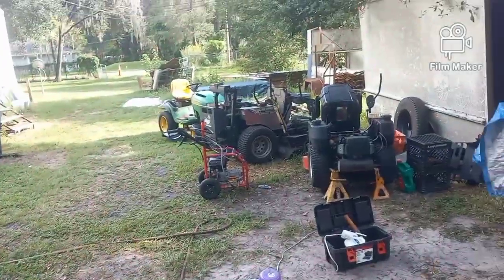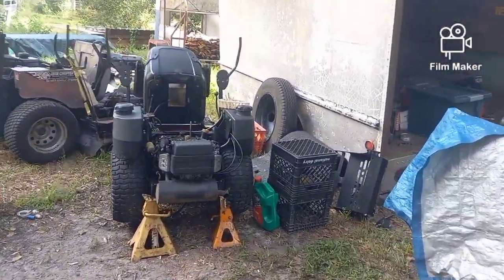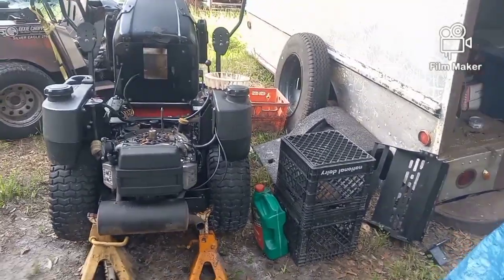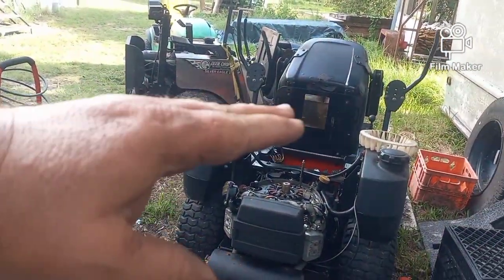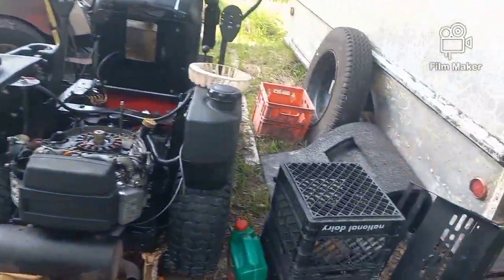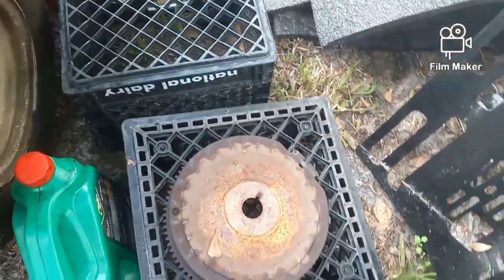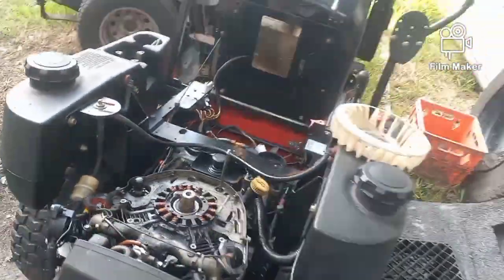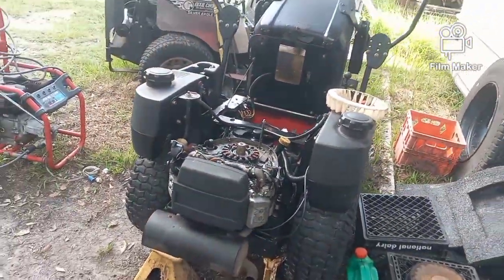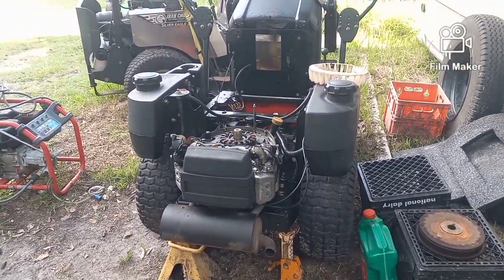And so what I'm going to do to try to save this motor, if that's the issue, if there's an oil leak that you can't find, a noise you can't find, and when you push on your... see, brain farts. I got to stop filming today. When you push on your flywheel, if it goes like this or it goes back and forth, that means you have a wobble in your crankshaft. So look on your particular machine and see if they sell a press fit. See, I forgot what it was called. Bushing.